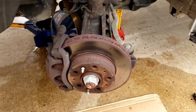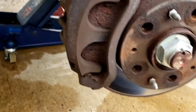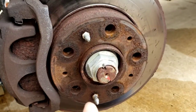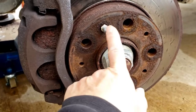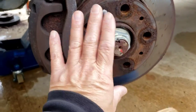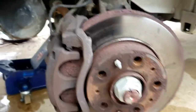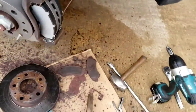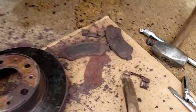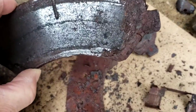I'm going to do the front brakes on this bad boy. Suckers are pretty heavy. I'm just going to show you this side here, then I'm going to show you the other side. There are a couple of retaining screws over here — looks like guide pins too when you put the wheels back on. On this side, if you notice, the brakes are pretty bad. They're worn out to almost nothing. This thing's already disintegrated.